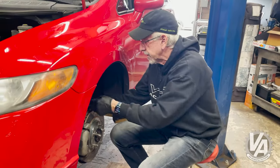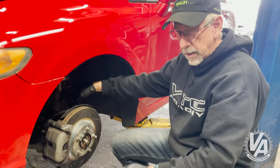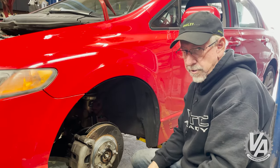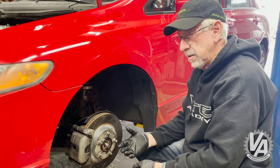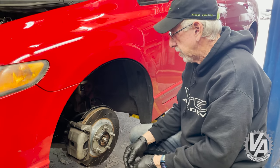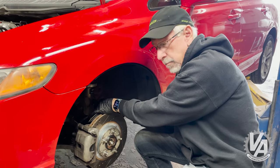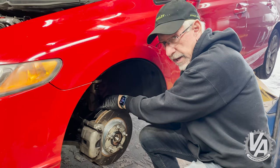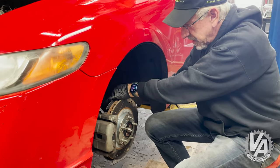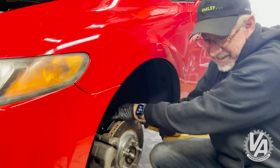After just a little bit of internet searching, this is an SPC cam bolt on top and they specify 77 foot-pounds. The bottom bolt is a Honda bolt and the consensus is about 70 foot-pounds. Honda asked for 62 foot-pounds, but it's an M14 — you can torque it tighter than that. We've torqued it to 70 foot-pounds. We're now in the last stages of putting it all back together. Aaron is actually working on the other side and will install that one over there.